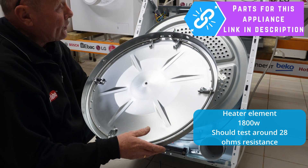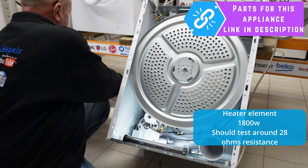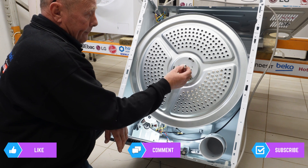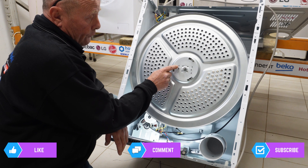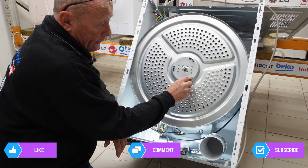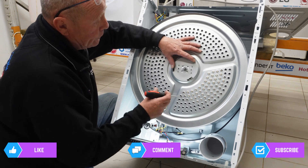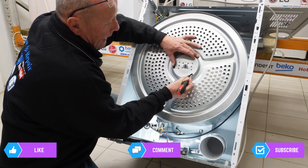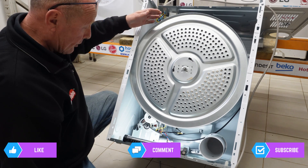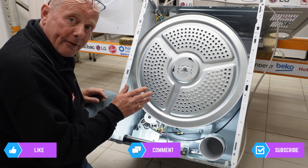Then it's straightforward to replace — you'll just need to undo the screws around here to replace the heating element. But while I've got this off, I'm going to show you this ludicrous bearing assembly. You've got a little bush here which sits on top, and the screws for the actual bearing cover are underneath. You've got one retention lug that you need to press down to take that cover off on the inside. Just press down this pin and rotate — then the cover will come away. I'm now going to lift the drum out of this machine to show you the bearing assembly for anyone wanting to change the bearing in the future.